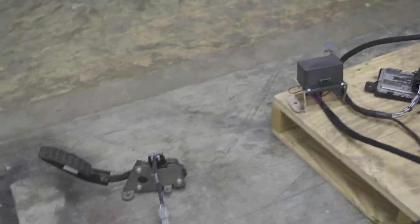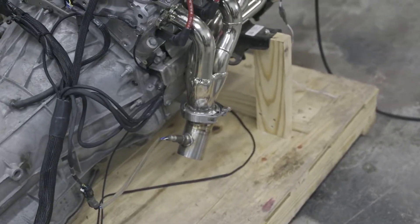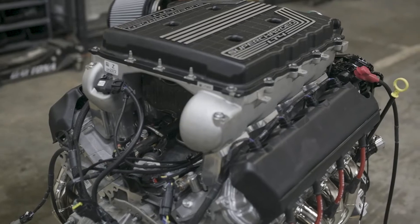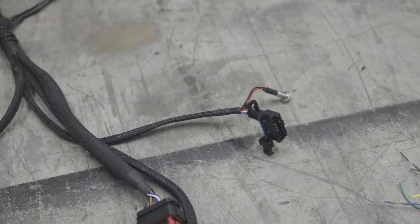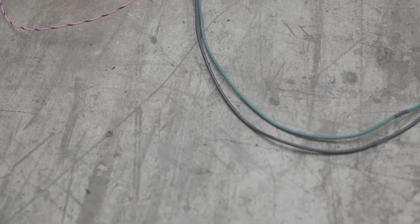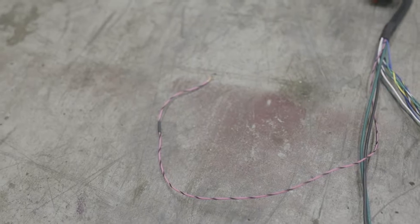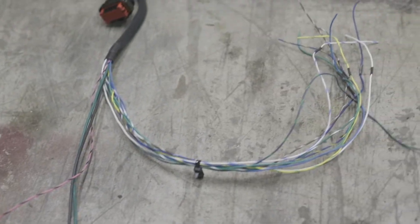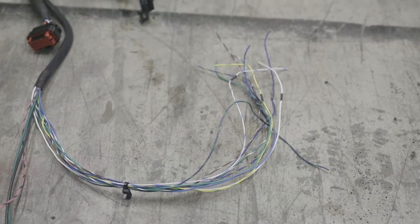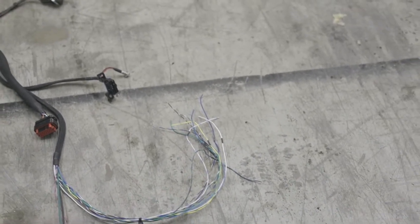All the complete packages will come with the pedal, the O2 sensors, and the mass airflow sensor. On the LTS, we do the LT4 map and then the breakout. So you have the OBD II, and then these are your three main wires: fuel, key-on ignition. And then these are for the CAN module — they'll do upshift, downshift, reverse lights, brake switch, stuff like that.